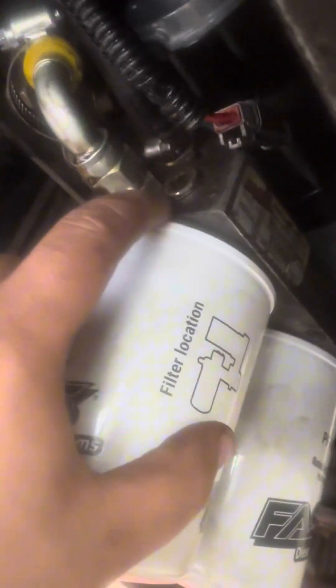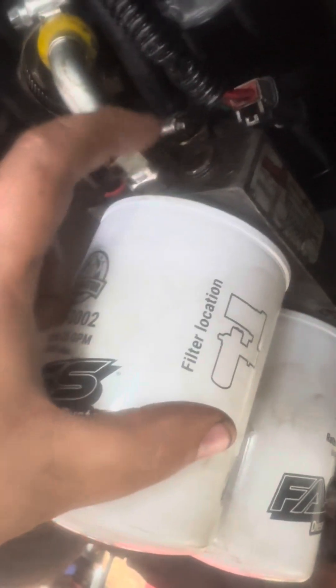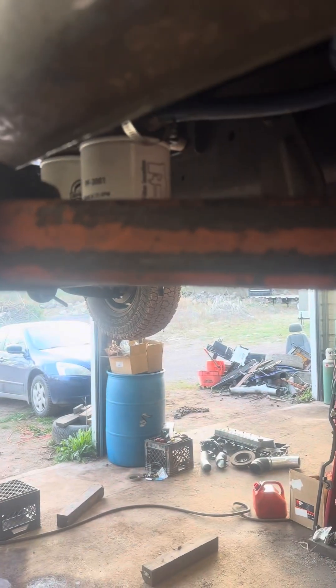I got the new pump up on there. I used Permatex between the pump and the base along with brand new O-rings for double protection, with the new bulb valve in there as well. I also put in the check valve internally between the pump and the base, put the new filters on, and put the new nipple in with the proper spring and a new check valve ball. That way there's no back-flush from the P pump back through the pump every time I shut it off — once it's primed up it should stay primed. I got the main fuel line hooked up and mostly ran.